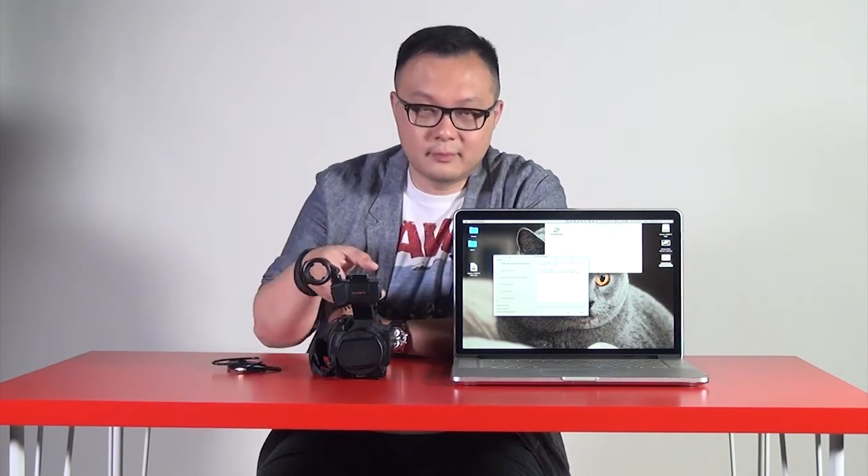If you want to know more about this 4K update, you can visit ANS or Sony. For the X70 firmware upgrade to version 2.0, it's pretty straightforward. What you need is a USB cable, your X70, and a computer. Make sure your computer has sleep mode disabled, because the firmware upgrade will take almost around 15 minutes.